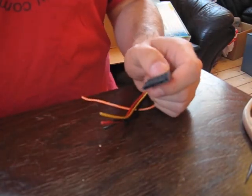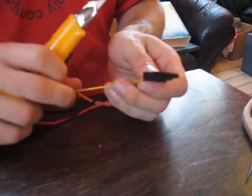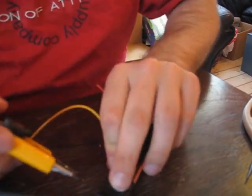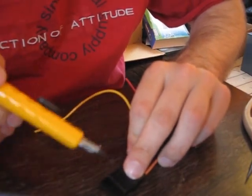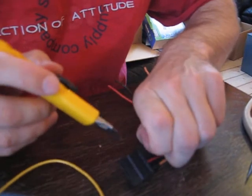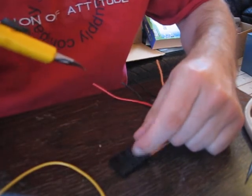How does one make an 8-pin EPS cable, or any changes to it? Well, it depends on the plug and how you can reuse it. This one, I think, came with one of my Asus motherboards. So let's see — there is a little tab here I need to pull. There we go. Then I can remake this plug into something else. As you see now, if I just move the cables here, I have made an extra connector.